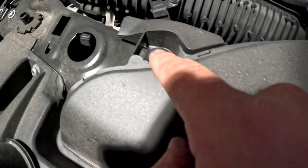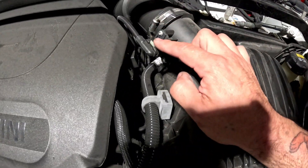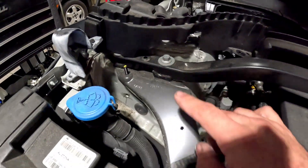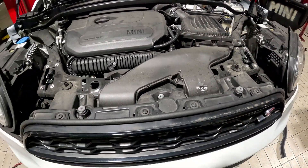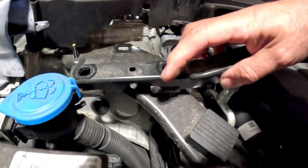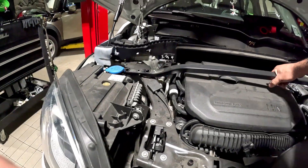10mm, 10mm, and then we'll remove the air box. You don't have to unplug it — I'll show you how I flip it over. The 10mm bolts are on the bracket across the two tens, and we'll work underneath the bar. The bar that comes off does have little arrows — make sure the arrow is pointing forward on both sides so you don't flip it on backwards.